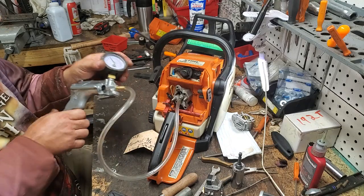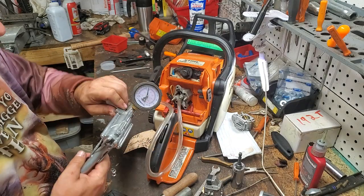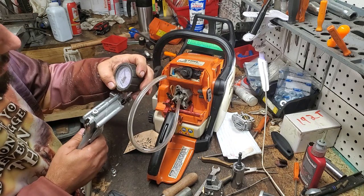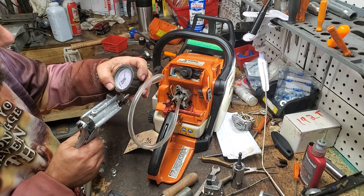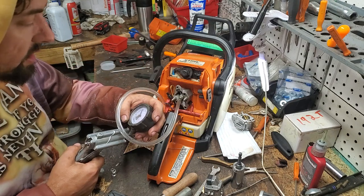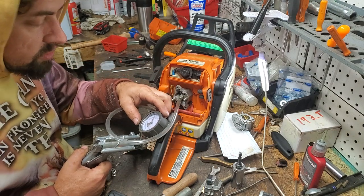So here we go. We're going to go ahead, neighbors, and we'll do vacuum first. We're going to go to either 5 or 7.5 pounds. I like to go to 7.5 because then I don't have to wait as long. And then we literally are just going to watch this.